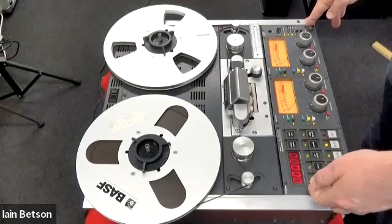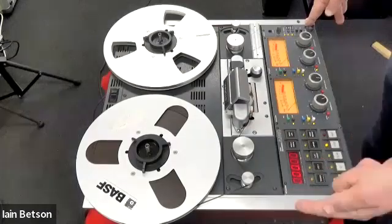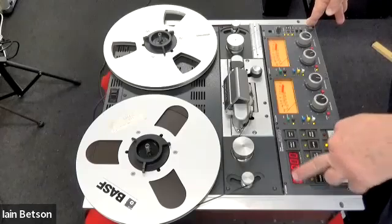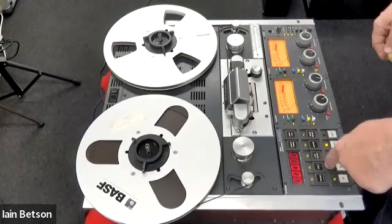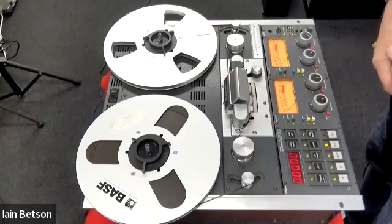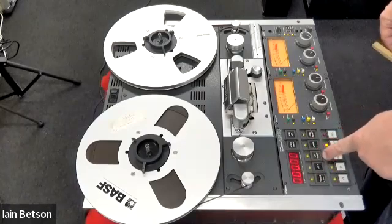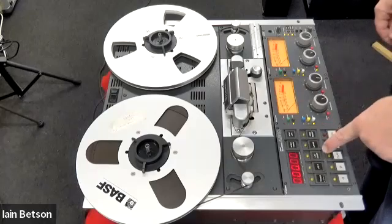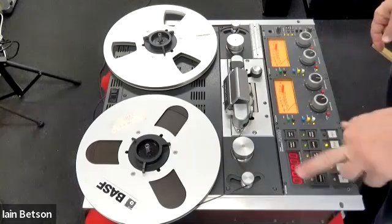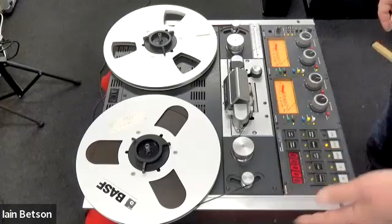These controls here you can use if you wish. The first one is called trans. You've got lock one — if the counter is at two minutes, you can press trans then lock one and it'll store two minutes under the lock one button. You can then carry on playing, press lock one and it'll rewind back to two minutes into the tape. Similarly, you've got lock start: press it and it'll rewind to the counter number held in memory under lock one and then go straight into play.